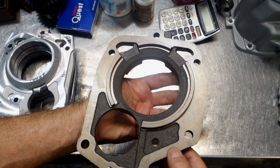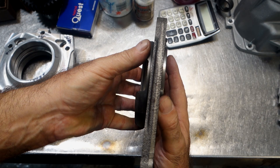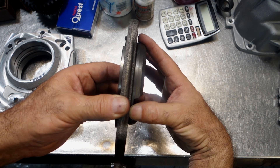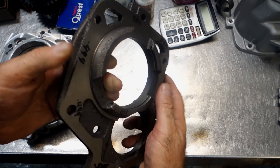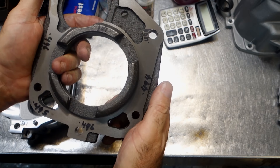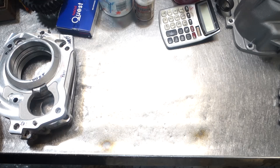Next up is the plate you've probably seen on eBay - it's a knockoff of the Auto Gear plate. One problem you can immediately see is that it's done on a lathe. It's extremely hard to machine surfaces parallel on the lathe unless you really know what you're doing, and they walk all over the place. Both locating areas here and here are way off on their size, so the plate doesn't even locate properly within the extension housing and the main case. The locating area is very roughly machined - it's not a fit to the case as it should be. This plate has an eleven thousandths variance, going from 0.505 down to 0.494, which is not acceptable. That's going to cock your main shaft way over and cause extreme bushing and pilot bushing wear in your engine.